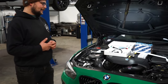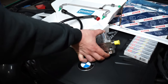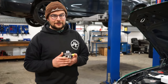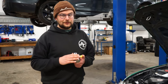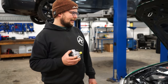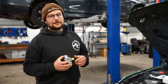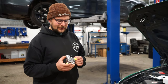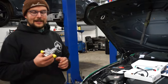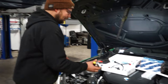The headline item is the Dorch DS25 fuel pump. This is essentially an updated version of the Dorch Stage 2, which is always the go-to fuel pump. Dorch have given it better flow along with a few updates to the kit. It now all fits without having to remove the fuel lines every time you want to do spark plugs, which is a nice little addition because that was a bit of a pain with the old kit. Some quite significant flow increases - maybe see how much ethanol we can flow through it with decent power. It'd be nice to flow a nice high percentage on there.